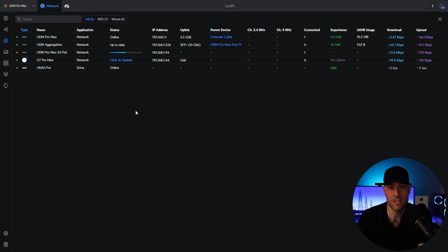Now, as the devices are adopting, what you're going to see is that some of them might have updates. So after it is adopted, what you can do is click to update the device, and then it will run through and update the device, and we'll connect back as soon as everything is adopted and updated. Okay, so after everything has been adopted and updated, what you'll see is that everything has been assigned an IP address. You'll also know the type of uplink that it's using, as well as exactly which parent device it's connected to.